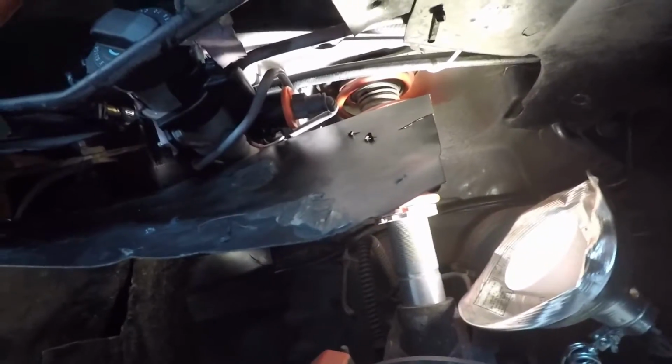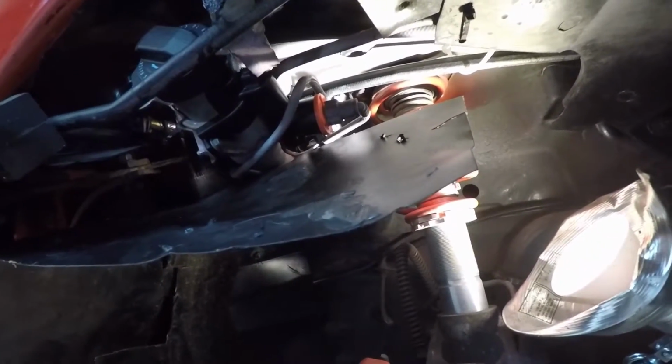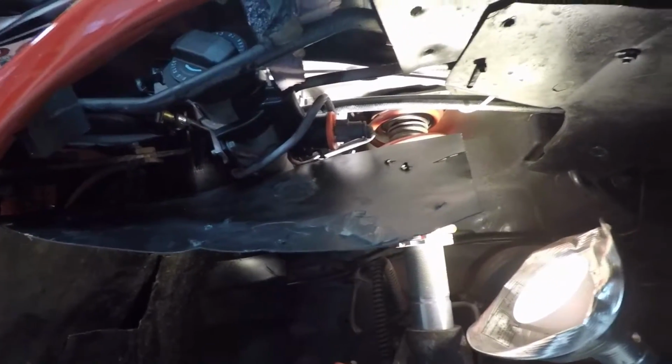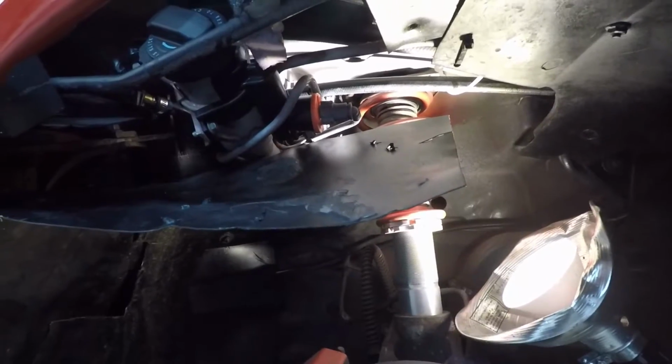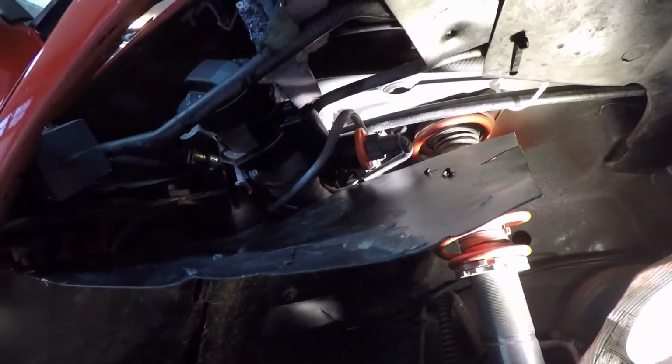And I never had that problem until a couple weeks ago. It was the first time I've ever had this problem. I see so many other people have this problem, and that's exactly what my case was. So I think the easiest thing to troubleshoot would be to not buy all kinds of parts and start looking underneath the car for emission lines, because the codes are not always accurate. Sometimes they'll say there's a minor leak or a major leak, and it could send you off on a wild goose chase. The easiest thing is, like I showed you earlier, listen for that clicking noise. That'll trump anything else you have, unless you have multiple problems, but that's pretty much the easiest one to fix.